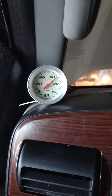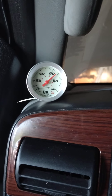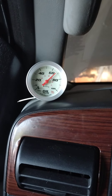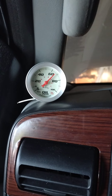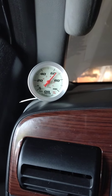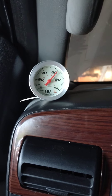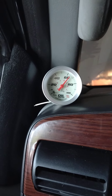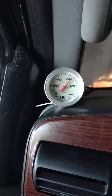We'll start our break-in procedure — I might wait until I put the fan and fan clutch on and figure out what the heck is going on with this coolant temperature sensor and why it's being wonky. I know I hooked it up, I remember hooking it up — so it didn't get clipped, maybe I bumped it off. I don't know, I'll check it after a while. That's awesome though — 60 to 65 pounds of oil pressure at 2,000 RPM.